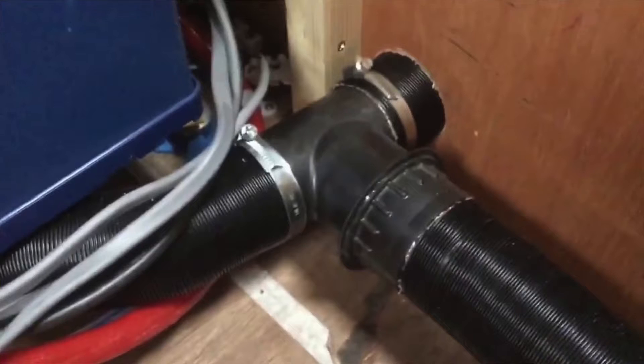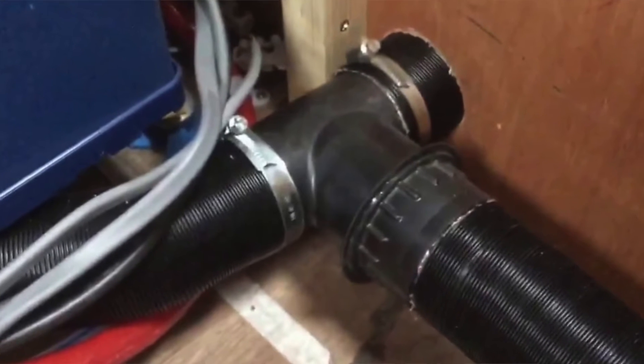Back home to review the results. About my air heater: just after 10 minutes it was already very hot and blowing hot air around the van, heating the kitchen wall to 13°C. It would be nice to have air vents for better hot air distribution — highly recommended if you're doing a van conversion. After 25 minutes the temperature rose above freezing near the kitchen at plus 4°C, and the kitchen wall was already plus 26°C. After one hour it was pretty comfortable inside, with temperatures of about 12–15°C around the van.